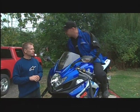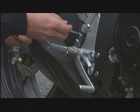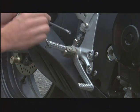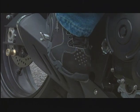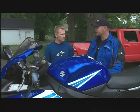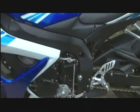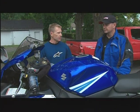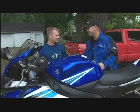The same applies for the foot levers — you can adjust the brake and the shifter. You'll need to have your riding gear and boots on for that. The brake pedal is all adjustable in the back. Where you want it ideally, in your normal riding position, is about two or three millimeters below your toe. I don't want to depress the lever too far before I get contact — you have more feel that way. And the shift pedal should be comfortable, because in an emergency you need to drop a gear immediately without thinking. Looks like we just need a couple of wrenches from the toolbox.